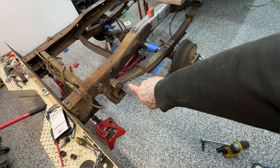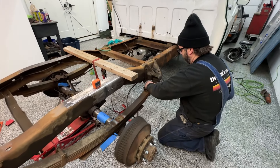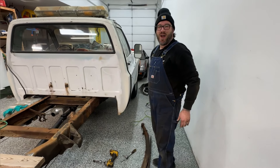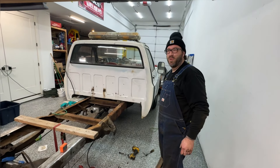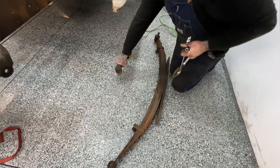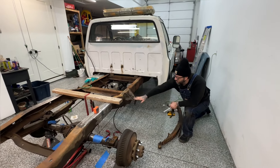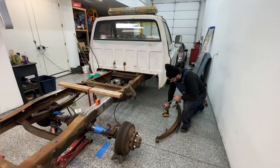Now we're going to remove the leaf bolts on each side, and this thing should be floating. Now let's see what this axle does. She floats. You should go leave that in one of your neighbor's driveways — just drop it off, tuck it under a lot. We'll load it up into my truck bed and start driving through the neighborhood, offloading them wherever we feel is necessary. I can't believe these don't sag. I wonder if they had a whole lot more arch in them originally. Other ways to lower it besides lowering shackles: flip the axle on top, remove leaves, or move the mount up.